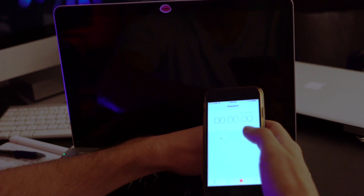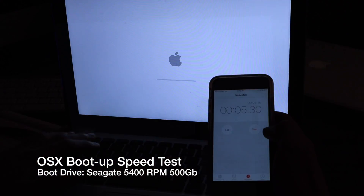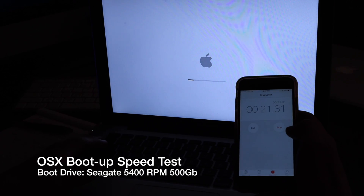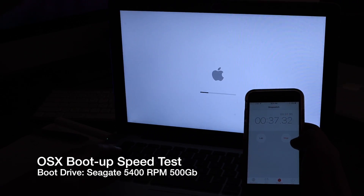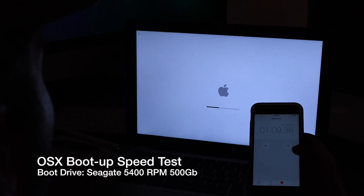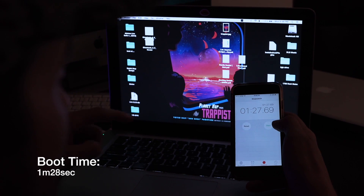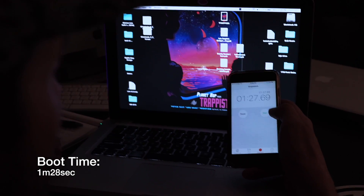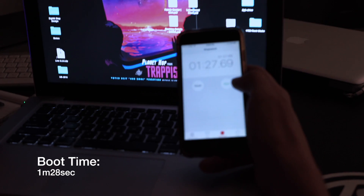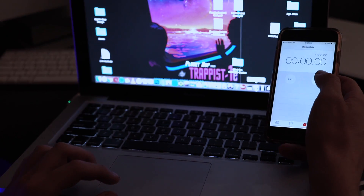I started by clocking the start-up times with the OS and two processor-heavy apps. For the first speed test, we'll see how fast the Seagate 5400 RPM boots up OSX. I went ahead and sped up the video a little bit here as I got the stopwatch going. So a minute 27.69 for the boot up using the 5400 RPM drive. It isn't horrible, but it's not that great — it's somewhere in the middle as far as performance.